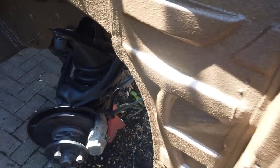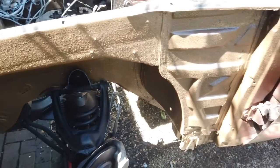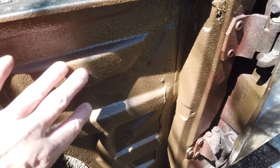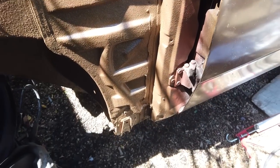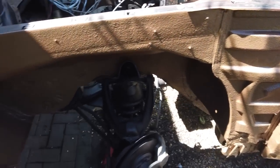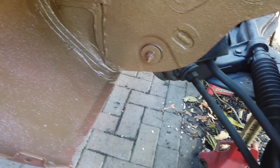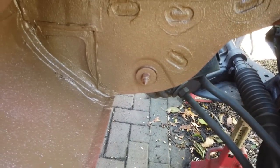Okay, we're done there, and one tub, 1 litre gives us just enough for both wings, both inner wings, and just a little bit of the back. I'll show you. So we've got that. It's a nice finish. I think we're drying already, or curing already. If it's a 2-pack hardener, it's curing, isn't it? It'll take another coat, a light coat, so we're going to get another litre, but that'll do us the back tubs and the second coat on here.